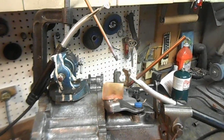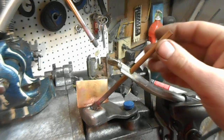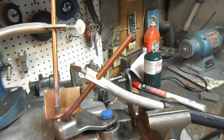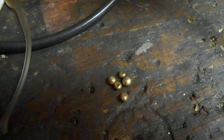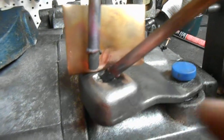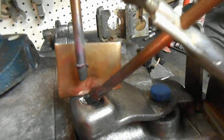What I'm going to do is set up my carbon arc torch. This is the power side, this is the ground, and each electrode is supported by a vise. When I lower this electrode down in there, I can have one electrode there and then lower the other one down at the same time. When those electrodes come within a sixteenth or an eighth of an inch of each other, an arc will start between them. When I have that arc started, then I'll be melting beads of brazing rod — I'll put a couple of beads of brazing rod in there at a time, put the carbons down, start the arc, and melt it all into place.